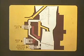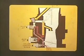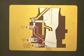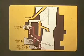This section of the idle circuit diagram shows the fuel about to be mixed with incoming air. The vacuum, which is below the throttle plate at idle, draws fuel from the float bowl through the main jet to the pilot jet. Air for the pilot jet is drawn into the circuit through a calibrated hole at the top of the carburetor. The fuel and air meet and mix at the pilot jet, and this mixture travels to the volume control screw where the amount or volume of this mixture is controlled before being allowed to be drawn into the engine.